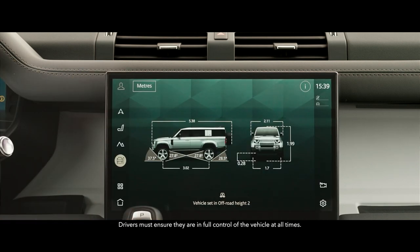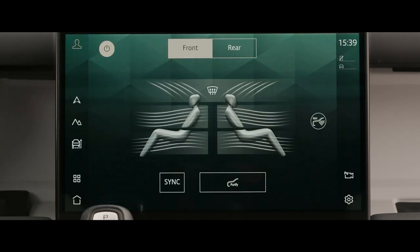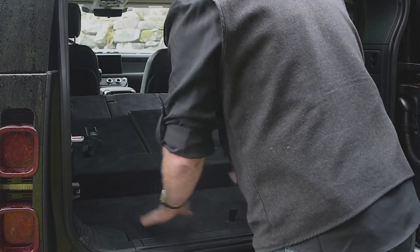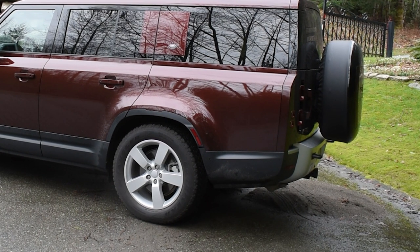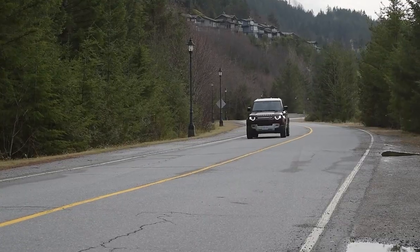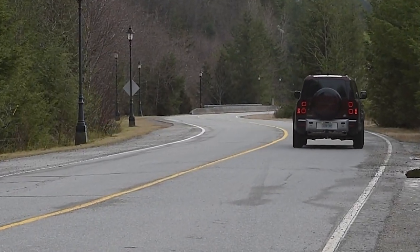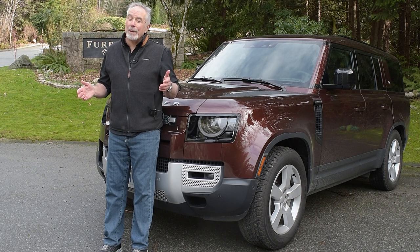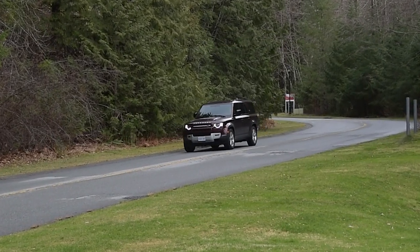The infotainment screen is undersized, but the software is very easy to manage — intuitive. There is a ballroom of space inside, and that third row is functional, spacious enough for adults. The tricky bit is that to provide that space, there is a 149-centimeter rear overhang, which impacts off-roading, and the departure angle is compromised too. Ground clearance is 29 centimeters, and the suspension articulates up to 43 centimeters, which is a big deal. You can expect to get something like 12 to 13 liters per 100 kilometers.